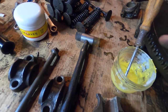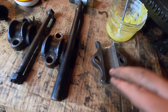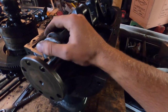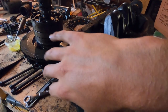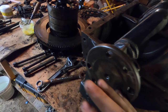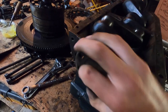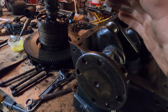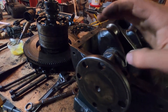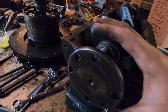I'm going to take a little bit of that powder, mix it with some engine oil to a light paste. Then I'll put a little bit of that on the bearings — on each side of the main bearing cap — and place it in the engine block with the rest of the crank and the other bearings installed. Tighten it down finger tight, then turn it. I'll probably need a turning bar bolted to the flange because it'll be stiff. As it wears down the high spots, you tighten the bolts a little bit every couple of turns.